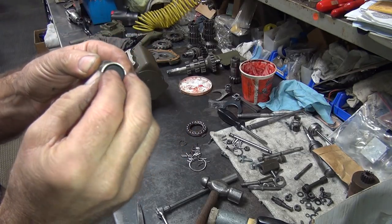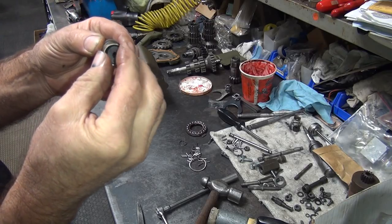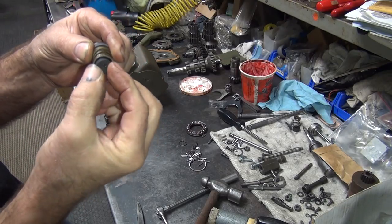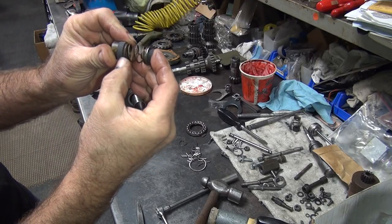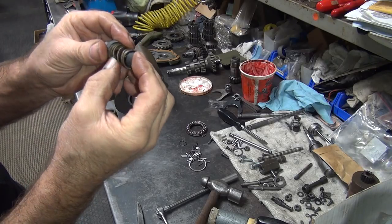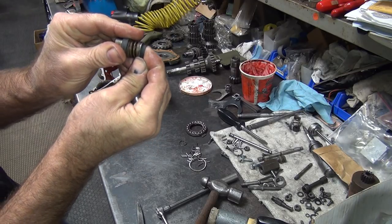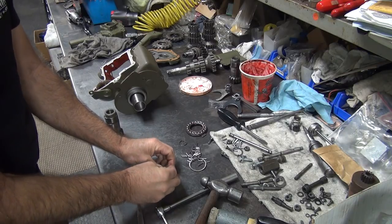And this little small rubber goes inside the cup. So what this does is this hits against the end of the main shaft, which seals the end of the main shaft. The cup collapses it onto the push rod so it stays tight on the push rod. So as things wear, it's constantly putting a pressure toward the inside and toward the outside where it rubs. And this is a secondary seal way out here for both the OD and the ID. But there's nothing to keep it tighter, just pressure against the clip. So that whole system all goes together like that inside your clutch gear. That's how it's supposed to be.